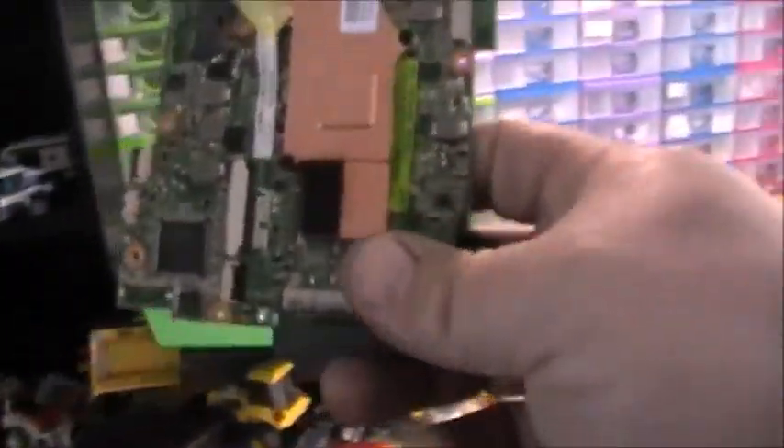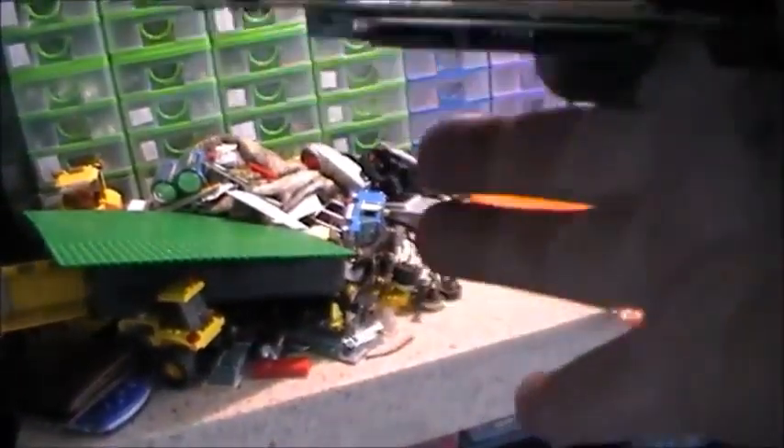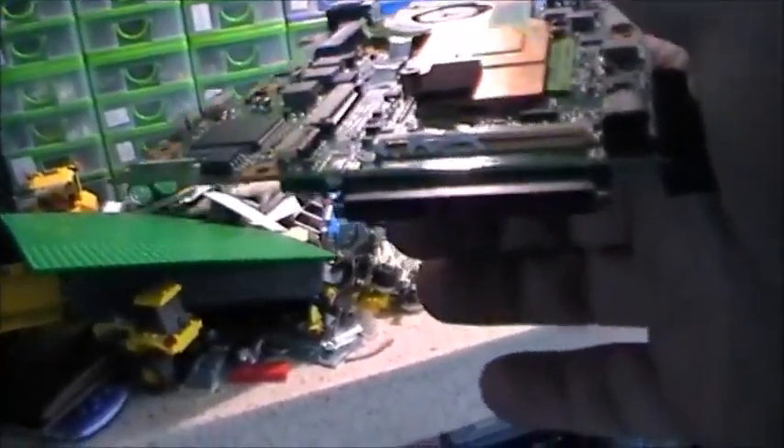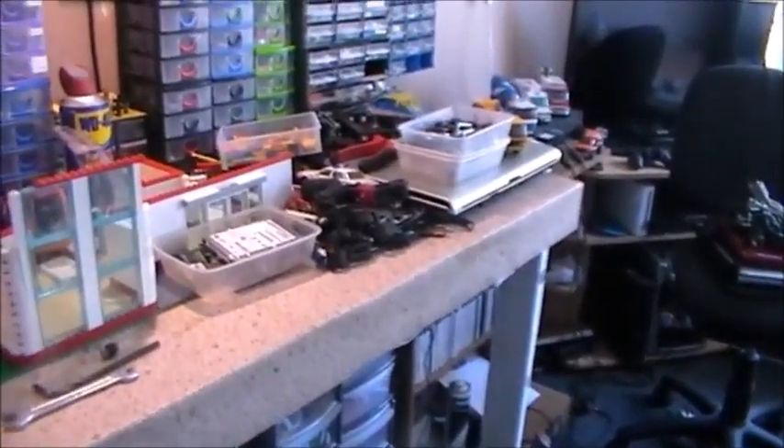Just before I continue, there's news on my little Asus down there, the pink one. It's basically dead. The problem is it's not registering hard drives. There's the hard drive connector, and it doesn't matter what hard drive I put on there, it's not recognising that there's a hard drive. So it's either a problem with this or a problem with the BIOS. Either way, it's not worth it. So I've just broken it for parts.